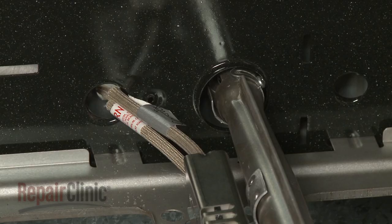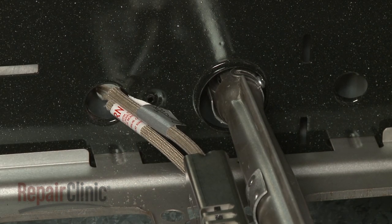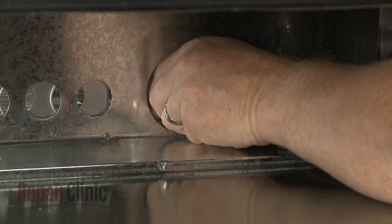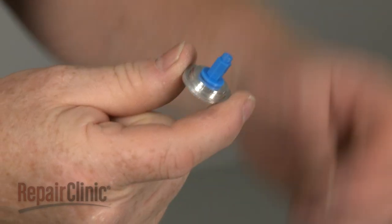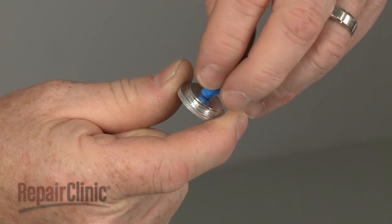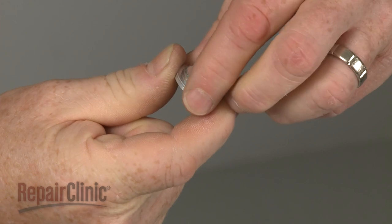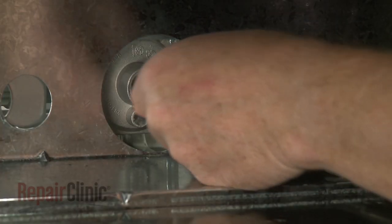Be aware you may need to adjust the air shutter on the burner tube to achieve a proper flame. Now use a large flathead screwdriver to unthread the regulator cap. Unthread the spring tension pin and thread the opposite end of the pin into the cap. Confirm that the washer is in place, then thread the cap back into the regulator and tighten.